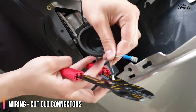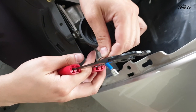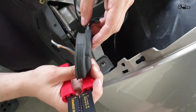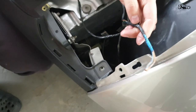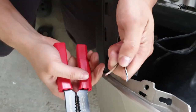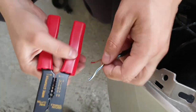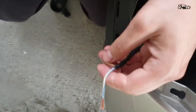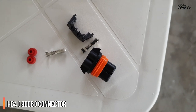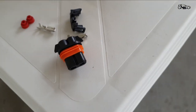So let's do the wiring now. As I mentioned before, you need to buy new connectors. The wires that we use for the lower beam will now be used by the new HB4 connector, which is the main power supply in this case. And the wires from the upper beam will be used by an AMP female connector, which operates the solenoid for the high beam. I bought these connectors from AliExpress due to price and I will leave links in the description, but you can feel free to search for them in other places as well.